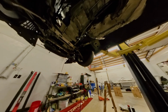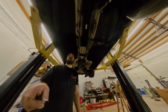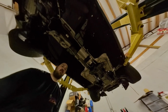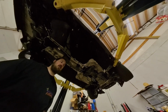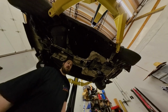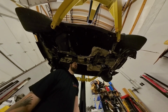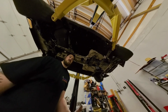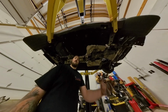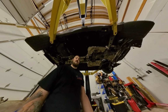And here's the underneath of this sucker. I'm more than likely going to redo my fuel system again so my regulator is where I want it and out of the way instead of in the way. It's kind of in the way of the head, the headers, the routing anyway. It's just really tight, and I don't like it being tight. Because if I try to access a spark plug, if I need to quickly remove it, I pretty much have to pull apart my fuel system, which is not good.